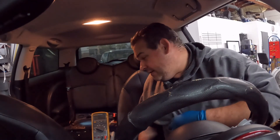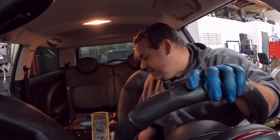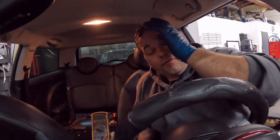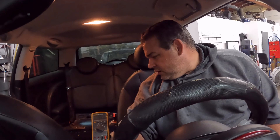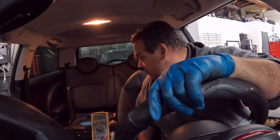I think it's a fuel pump, guys. I've got a spare I could test with, and I've also got a new one I could just throw in. There was no fault code for the low-pressure side or anything. It's getting late so I'll probably just do this tomorrow — but at least now you know the diagnostic procedure on this one. Thanks for stopping by.